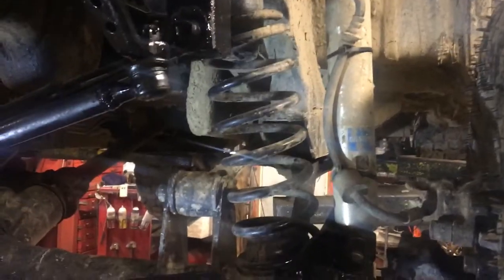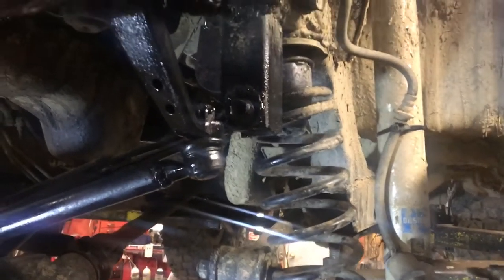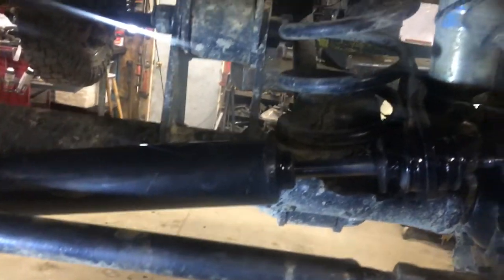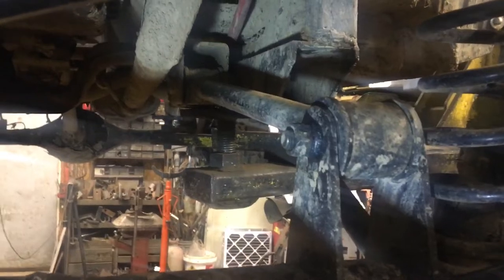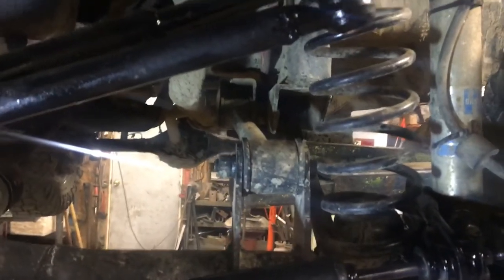A set of Bilsteins that came from a Jeep. The rear coil springs I put up front — cut the coil pockets off of the original front end, welded them to the frame, welded some to the axle. The links are three-linked and they're the bars like you see on the back of a Sidekick or Tracker. Put energy bushings in them because they were toast.